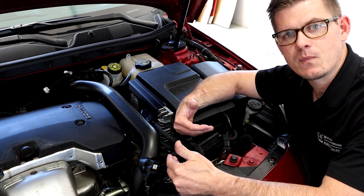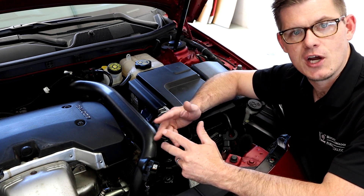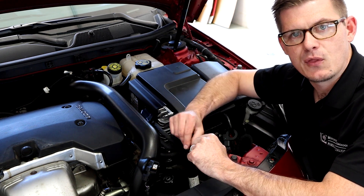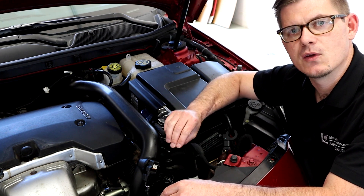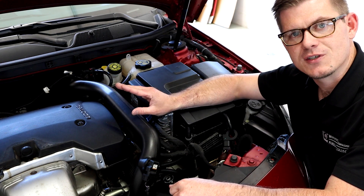That falls back to another system we use to modify our fuel quantity and fuel injection numbers — those are called fuel trims. We'll make another video about that in more detail, but the key thing here is that oxygen sensor data is used to make determinations about fuel trim numbers, and those fuel trim numbers make adjustments about how long our fuel injector stays open.